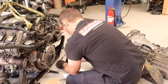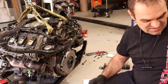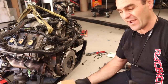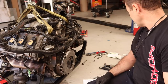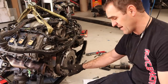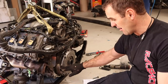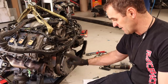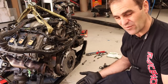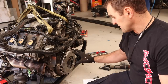I'm a little annoyed. The packaging that clutch came in from the US is very beaten up, and it's missing two bolts - one flywheel bolt and one pressure plate bolt. Pressure plate bolts are less important to be brand new hardware, so I've used one off of the old pressure plate. I'm going to have to go and get another flywheel bolt to match in with the other flywheel bolts - I may have to just get a new whole set of eight.